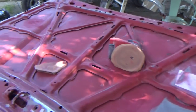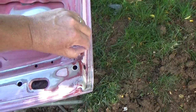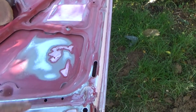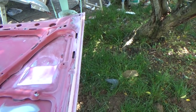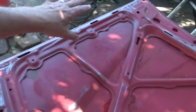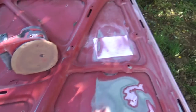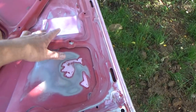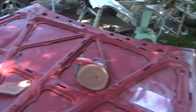I'm working on trying to get the hood prepped and it's a little harder than you would think, because where I originally sprayed it the red was shiny because it was underneath the hood — the paint wasn't really disturbed and it didn't stick real well, so I'm having to sand it down. It's flaking off. Got to get all this off and then I'll shoot some primer on the areas that I've sanded. I've also got some reproduction stickers coming for these, which will be super cool, but I'm spending a lot more time than I wanted to on the bottom side of the hood.